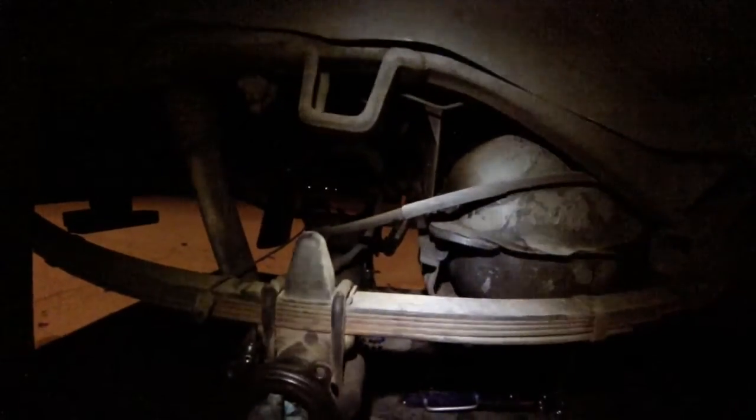Remember, when you get back to putting the axles in and the diff in, you get to the drive line, put it back, the e-brake back in, so that way you can torque down on those bolts. You can take the e-brake off anytime you want to rotate the drive shaft to get to any bolts that you're not using, as long as the tires are not on hitting the ground, because even then the tires are on, so that way it's going to add weight. So that's what I would do. When you get to the drive shaft, make sure the e-brake is on. That way you can torque them down and it grabs everything. I mean, if your brakes are good, it should grab.